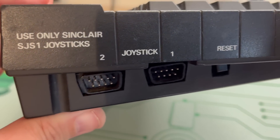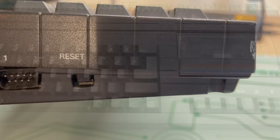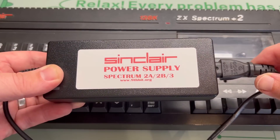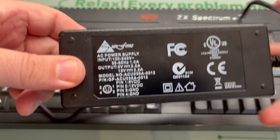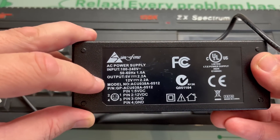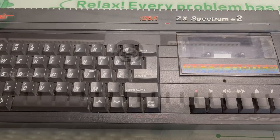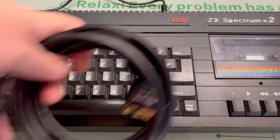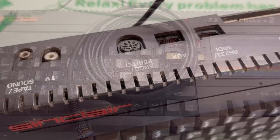On the left-hand side of the machine we have a pair of joystick ports and a very welcome reset switch. The machine didn't come with a power supply, so I grabbed this one, which was cheaper and should also be more reliable than the original unit. This power supply is missing the negative 12V feed, but that's only required for the RS-232 port, so we're not going to miss that. I also grabbed this SCART cable so we can get the benefit of that glorious RGB output.